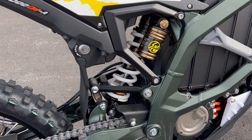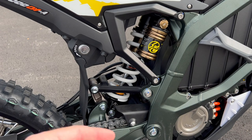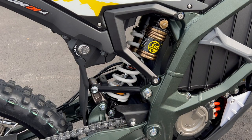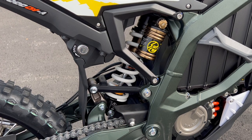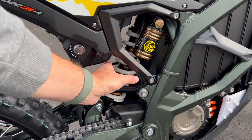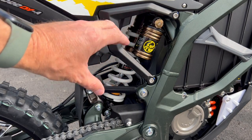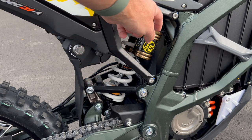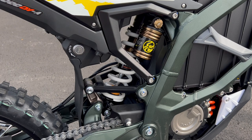I think that dirt bikes make sense in this area, but the problem with those dirt bikes is they're a little bit lower end and don't have the same type of suspension you can get on something like this. This does cost a little bit more than a KLX 300. But let's just take a look at what you have here. You've got your shock tucked in and forward to centralize it — it's a piggyback shock, which means as the shock does a lot of compression, the heat comes over to here. This allows you to have really consistent performance.